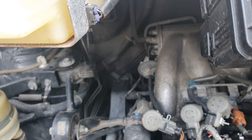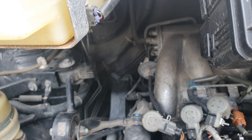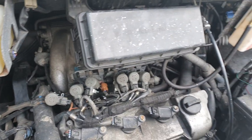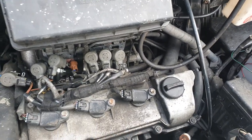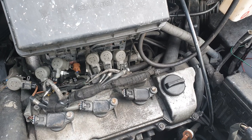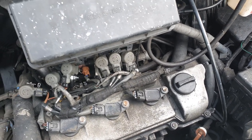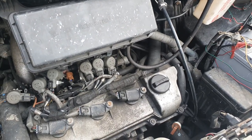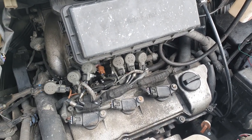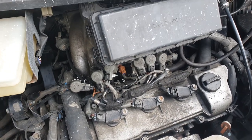What I'm going to do is change the engine oil just in case there's any condensate in there that could eat away at the insides of the engine. I'll probably do a double change of oil once the seals are all replaced, just to make sure we're not going to run into problems in the future. Being cautious as I always am with this engine.